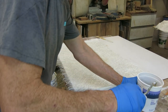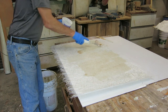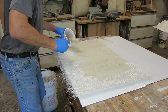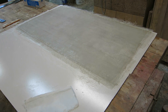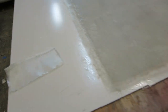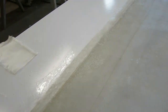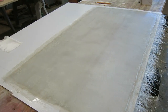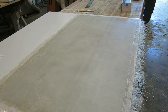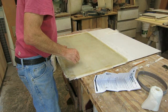I'm using the white hardboard as a base to roll out some glass. These two pieces have never been used, they're oiled, and the two pieces are put together with some packing tape — cross my fingers that the stuff will come off. I started out with a layer of chop, put a layer of the fabric that I hate, then another layer of chop and another layer of the fabric I don't like. When you try to roll out the air bubbles in this fabric you have to push them all the way to the side — it's like putting on a vinyl decal. The air just won't go through this fabric. Some bubbles came back, but it's looking pretty good for the first step in my new console — up high storage. Sticking was not a problem; it just fell off the white hardboard and the packing tape.